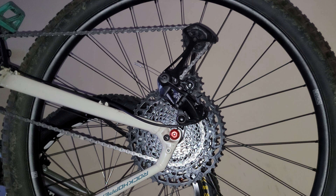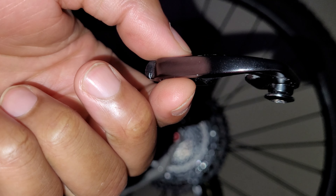I think I know what happened. When I was going through the door — the door has one of those tension springs that makes sure the door closes — what happened is when it hit the rear derailleur, my Shimano Altus, what I was running at the time, it bent it slightly a little bit inwards.